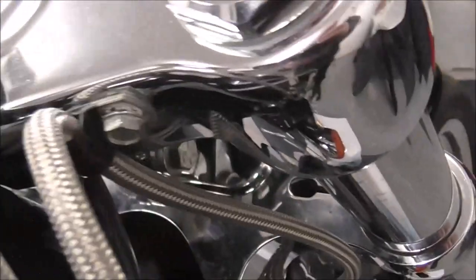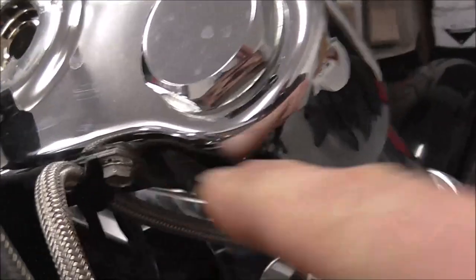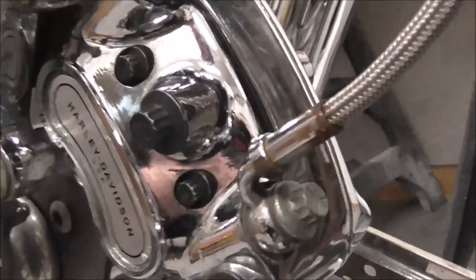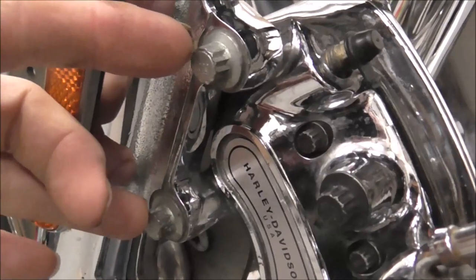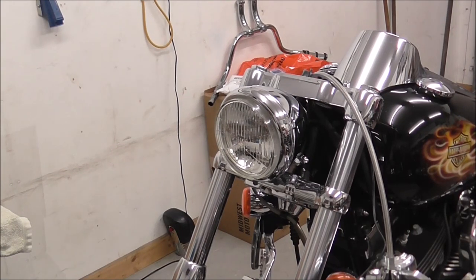On the back, you'll see there you've got the brake pipe coming up here and it's held on with a little bolt there. And then underneath there's another bracket that's held on with an Allen key. There's the bracket under there. Follow the pipe down, which in turn goes on to the caliper. The caliper, as most of you will know, is just held on with these two bolts. So to start with, I'll take the brackets off the pipe, and once we've got them freed off, I'll set you up in a different position and we'll get the caliper off.